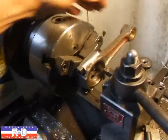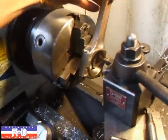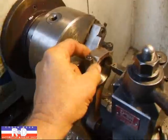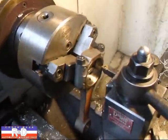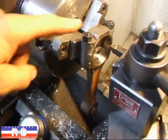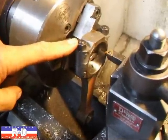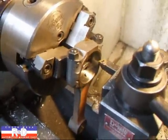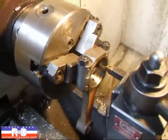Hi, it's John and Chris from Ace R&D. Today we have a Volkswagen Rabbit rod in the lathe, and we're going to narrow this down. We've already done one side so that we can use this in an air-cooled engine. We've also changed the bolts out to a heavier-duty bolt from a Chevrolet. Just kind of some of the stuff we do here. I'm going to show you how we narrow this down.